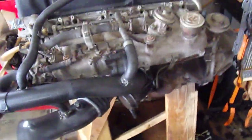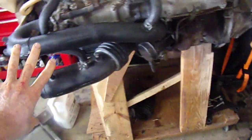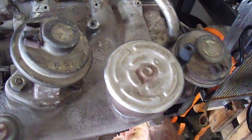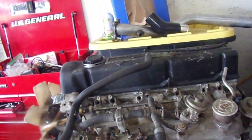I'm Jeff's engine. The intake charge tubes are installed, all the piping's hooked up, and the oil line to the turbo is installed - it wraps around the back of the engine and plugs in right there. I got a starter on it, I spun the engine after I pre-lubed the cam, spun up the engine to make sure the oil pressure came up to the turbo. I unbolted the drain from the turbo to make sure oil was pouring out, and it was. Turbo spins really nice, it's nice and free - no excessive play. It's got a little bit of play but it's a journal bearing, so that's okay.